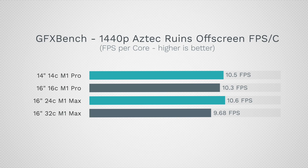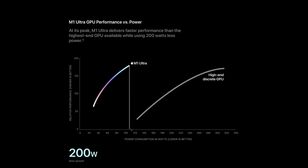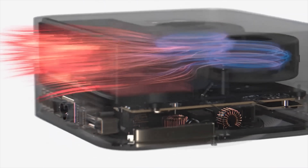Another thing we noticed with these chips in the laptops and in Apple's own charts is that we don't see complete perfect scaling. With the 32-core M1 Max in the laptop, it did not give proper scaling compared to the 24-core — it was a little limited. The same could happen here: if the M1 Max runs at 60 watts and you double the GPU cores going to the 64-core model, we're not seeing doubled wattage in Apple's charts, meaning there could be some performance limitations. I'd really question whether you need the extra graphics cores. The M1 Ultra with 48 cores is the sweet spot for both performance and cooling in that small chassis.